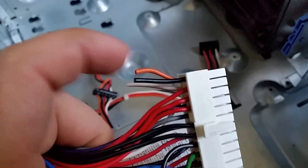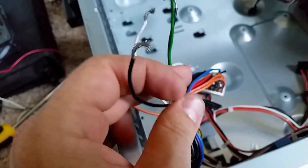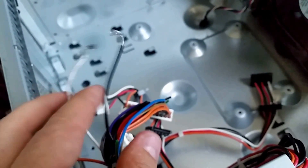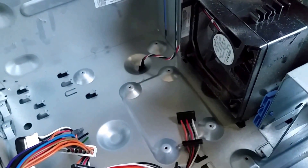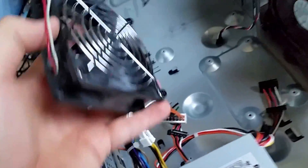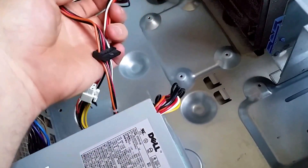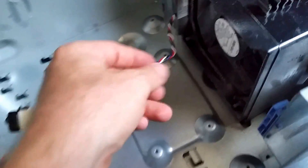This orange one — ignore that, it was just a mistake on my end. So when you go to look at the wires after you've cut them, you've got your ground and your green which turn on the power supply, then your negative black cable and your positive 12 volts. Here's the power supply and here's the computer. I'm going to try to utilize that fan right there to draw nice cool air into this box. Also I've got another fan that I'm going to plug into the back. Because of cutting it, these pins that are normally plugged into the computer are not going to fit — these are for the motherboard — so you have to cut these and figure out which one's positive and negative.